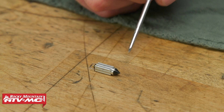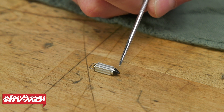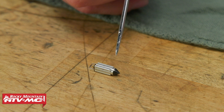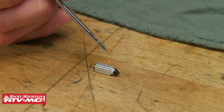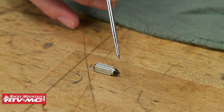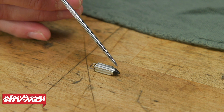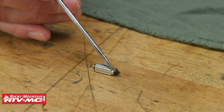On the other side, on this rubber tip, if you see a groove worn into that, this is going to make the float sit a little bit lower, and your height's going to be off. And most likely, it's going to be leaking as well. So if that happened to it, again, you're going to want to replace it. And then look at the brass fitting where this sits, make sure there's no damage there.